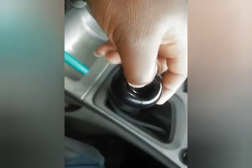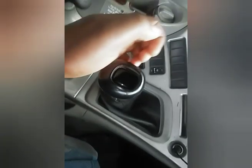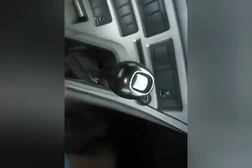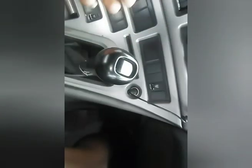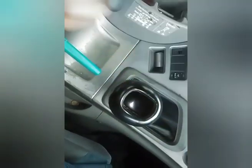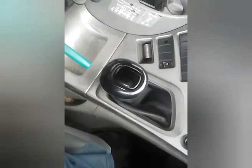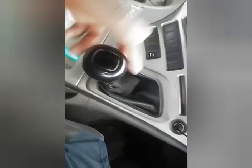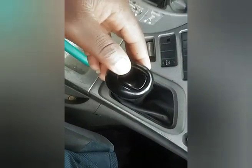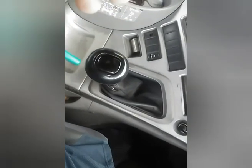Back to low, move to six low. High — press your clutch, your six high will be in. Back to six low again — seven low now. Press your clutch, seven high will be in. Back to seven low — eight low. Press the button here, then press your clutch. Every time when shifting up, you start with the splits first, then press your clutch. Now we are on gear number eight high.